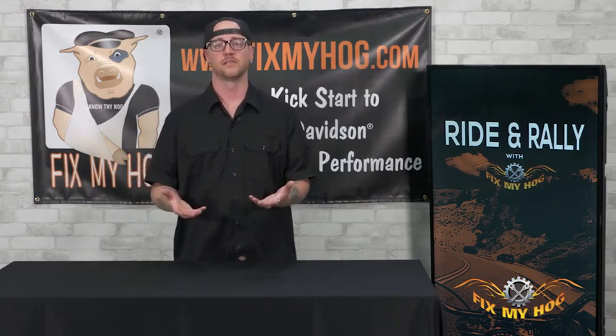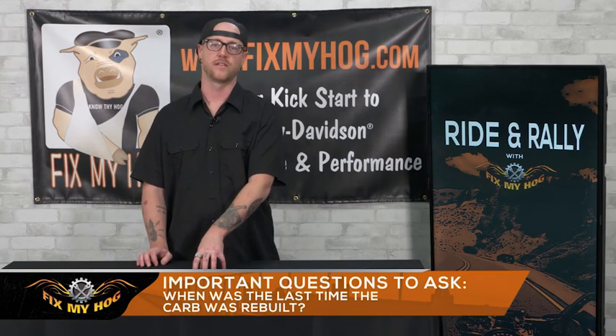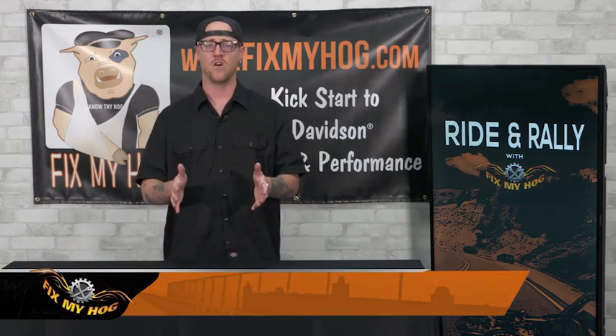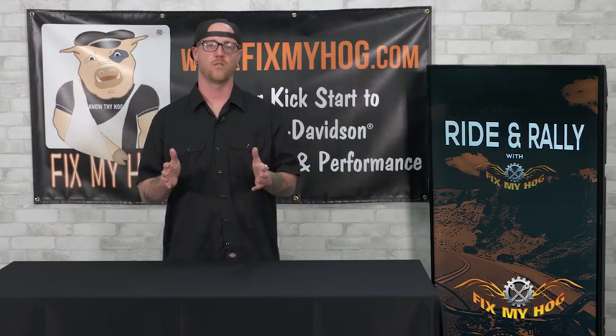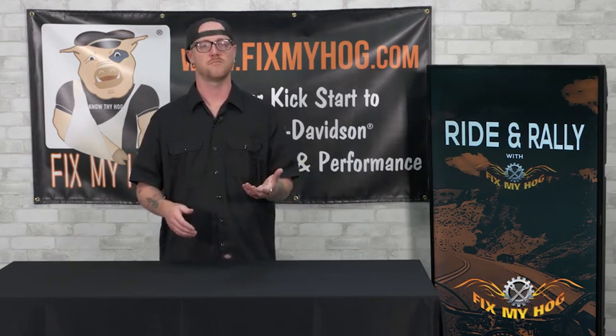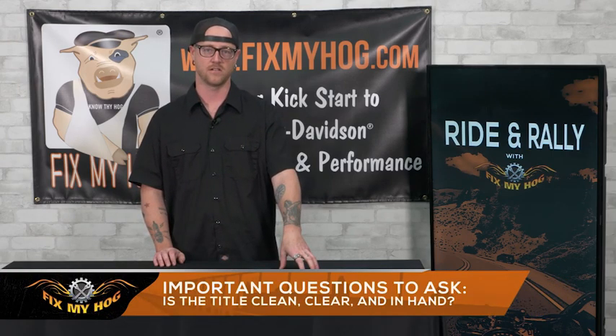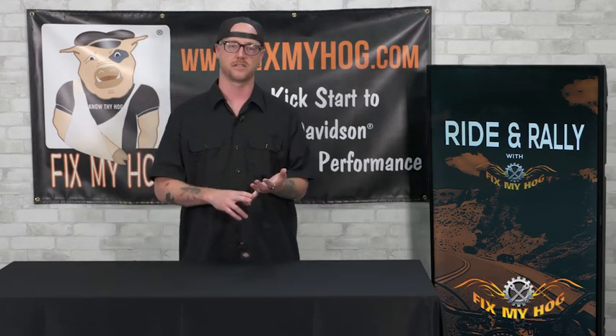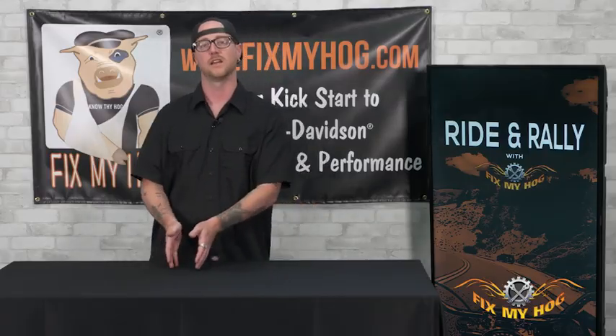You also have to think about titles. With older bikes, engines are often pulled out and put into different frames, and different transmissions are put in, which can affect the title. That was absolutely the case with my bike — it's a special construction title, titled as a 2014, even though the motor is out of a '76. It's a '76 motor put into a custom frame, which got titled and tagged, and I had to show the MSO for the new four-speed ratchet top transmission when titling the bike. When titling a special construction chopper, bobber, or vintage Harley, you really need to check your state's local laws. For example, my bike is titled as a 2014, so in a state like California it would be held to 2014 emission standards — meaning I'll never be able to take that bike into California. So absolutely ask about the title: is it clean and clear, is it a special construction, or is it titled as a Harley-Davidson for that year?